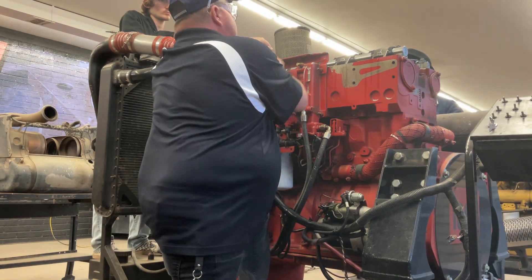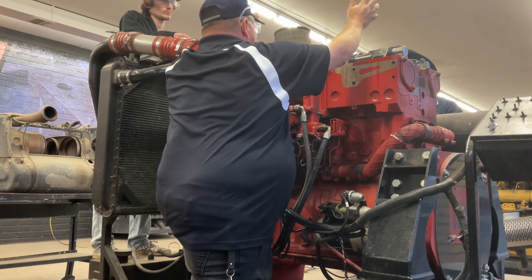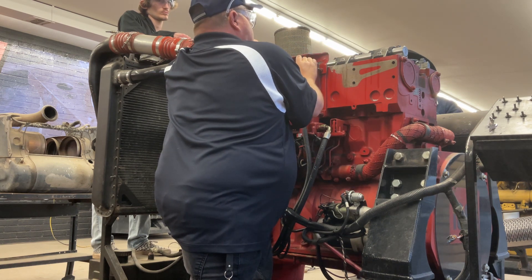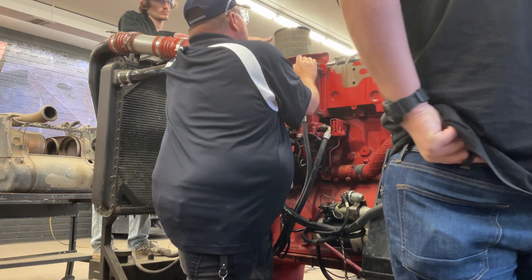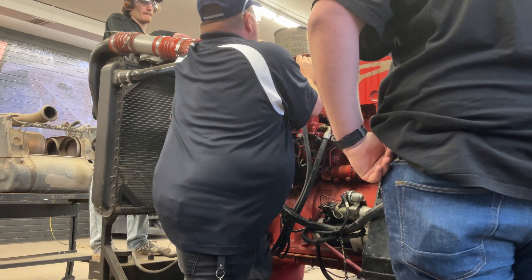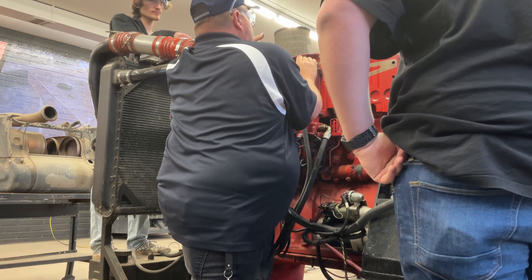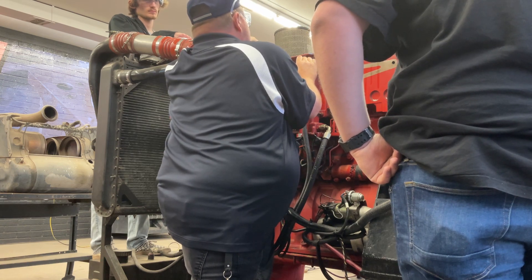What that tells me is that this one is working mechanically and hydraulically — everything is fine, and it's probably working electrically too. The reason it's not throwing brake actuation is because high brake mode is selected and this one isn't doing its job. So even though you pressed it down, it still didn't do anything. That could be a misadjustment with the adjusting screws, leaking valves, or an oil leak — meaning someone didn't torque down that rocker shaft correctly. So this helps us eliminate suspects.